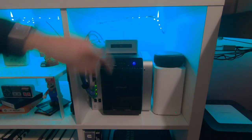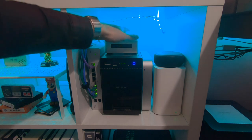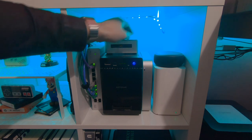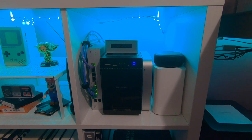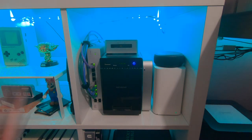I've got two of them, so I've got redundancy. I've got VMs sitting on here and on here, and I can move the VMs between those two servers quite easily — I'll call them servers because they're acting like servers. I've also got two for redundancy, so all of my virtual servers running on one, if that device was to die or have a power outage, they all automatically power on on the other. That is using a technology called vCenter, which is another suite by VMware. The whole point of having these two in a small form factor was really for space reasons, but still powerful enough to run multiple servers.